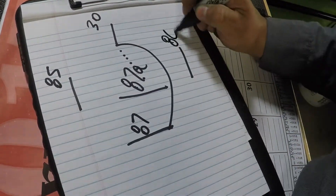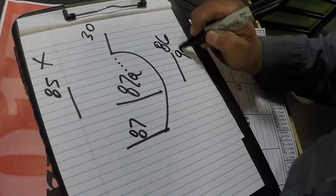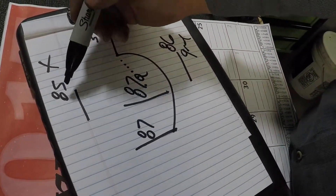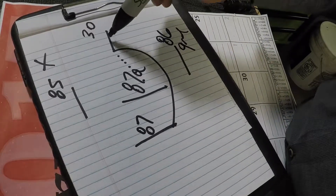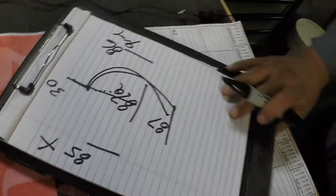The way you toggle this relay on is by activating pins 85 and 86. I usually put power and ground here, and whenever you connect power and ground you're going to hear a clicking noise coming out of your relay. All that clicking is doing is switching the connection from 87a to 87.